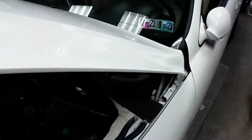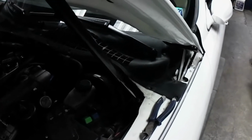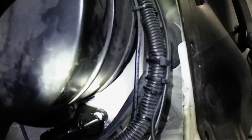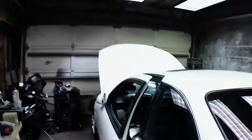So I'm gonna put this camera down, and I'm going to start putting this in. Alright, so I got her in there. As you can see, that Wilwood is in. It has the little adapter there. The bolts need to go a little longer, and I'm gonna need to use the longer clevis. I just need to make the hole. That's the problem area, making the hole, because it's such a pain in the butt to get in here.